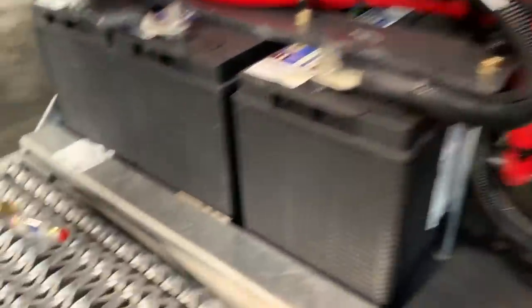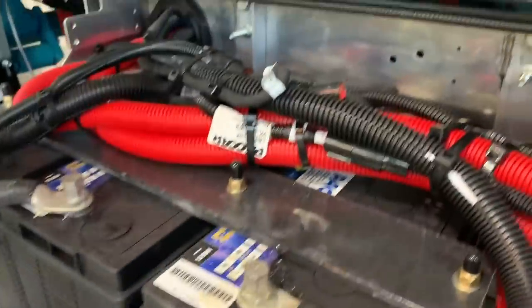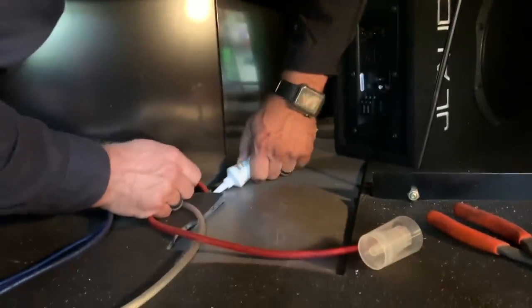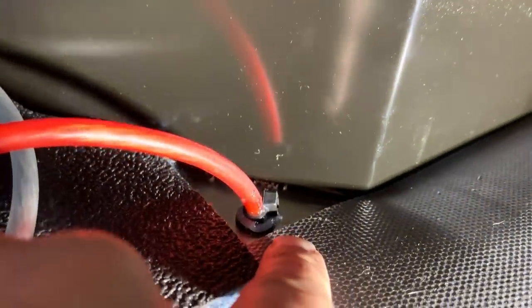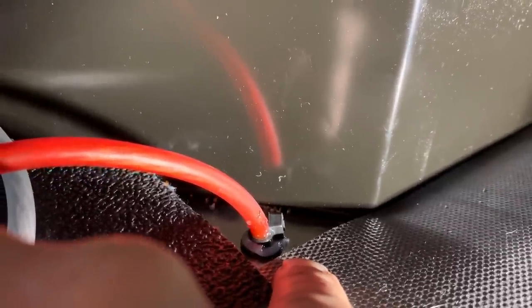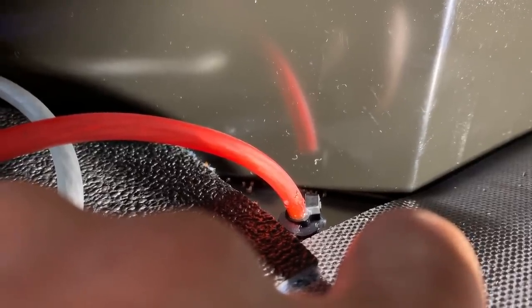As this comes through, we'll run it up under here and secure it to these cross members until we get down and hook it to the battery. Right there where the battery goes, we'll be putting an inline fuse — pretty simple process, not too terribly time consuming. Kevin's got the sub in here and the power wire run down to where the battery goes. It comes out right here, stays nice and tight, zip tied out of the way. Biggest thing when you're doing this: make sure you run these wires where they're not going to get constantly rubbed on metal, because eventually it'll chafe and cause it to ground out. Kevin also put a zip tie on top of the grommet so it'll never pull through too far, keeps it in place, then silicone in there to ensure it's nice and sealed.